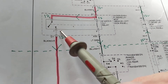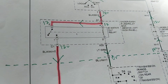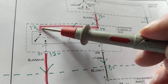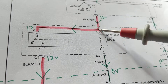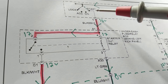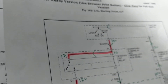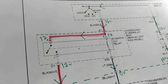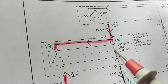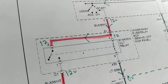I start closest to the load — 12 volts over here when the switch is closed. Let's say I don't have 12 volts, like the person who left the comment. Let's say I have zero volts here. I go over here and I have 12 volts. But note: this wire is common to both sides — that's the problem. Sometimes you have a separate circuit going to each side; in this case you have a common going to both. So if the ignition switch in the start position is bad, it'll affect both sides of this relay. That's why when someone asks how much to measure in the relay — it depends whether it's a separate circuit or a common.